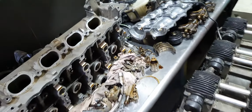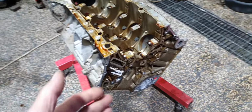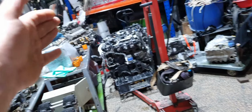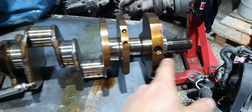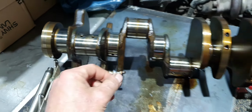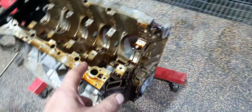Yeah. Now, all the time is the preparation. Preparing it, washing it, measuring. Same thing for the crankshaft. You see that it has burnt oil on it, but it's nice and shiny, fortunately. I didn't see any mark. Even the crankshaft rear seal, I didn't see any step or anything. It's not a high mileage engine, if you want my opinion. This is not a high mileage engine.